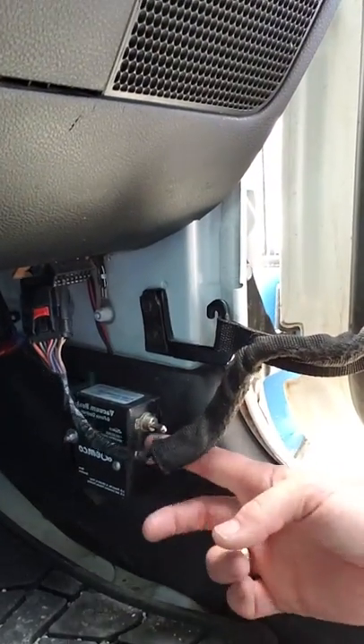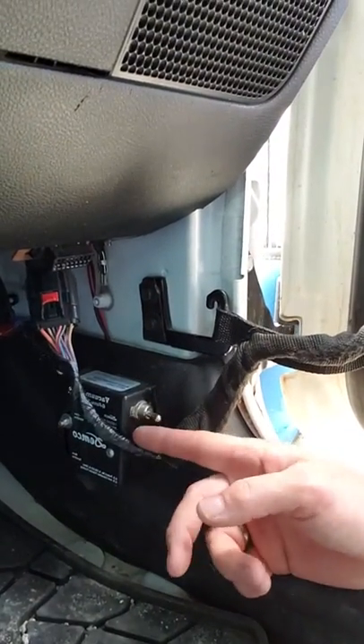It's down here on the floorboard, kind of hard to see. It has an on and off. So when you hook up your RV to your Jeep and have it hooked up, you need to put your Jeep in neutral. Then you put your transfer case in neutral. Then you put your Jeep in drive or reverse, whatever it is, and try to see if it'll move — that way you can assure that it's not in gear.